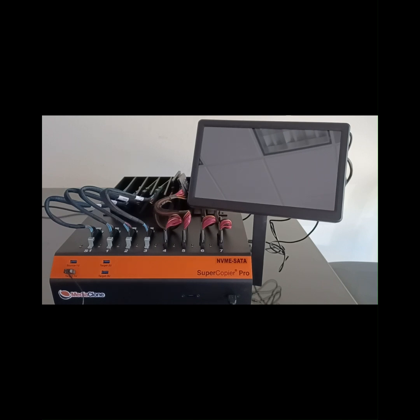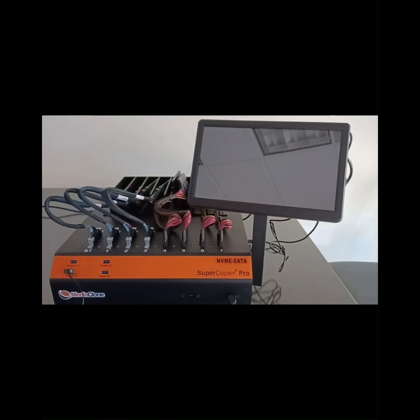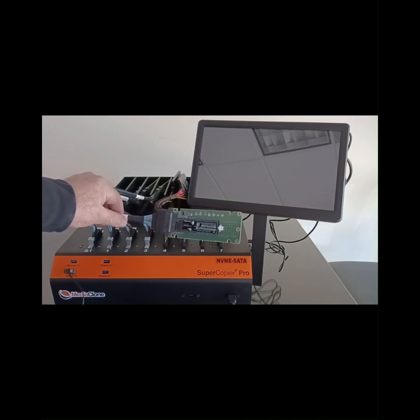Also, the unit has a built-in 4 U2 NVMe ports, and it's supplied with 4 M2 to U2 adapters that plug directly into the U2 ports. What is special about those M2 adapters is that they support 110 millimeter long NVMe SSDs and have an easy locking mechanism gadget that allows the user to pop the SSD in and out without needing to screw in the SSD. This is an example of the white gadgets. In the end, you just press on it and the SSD pops out.